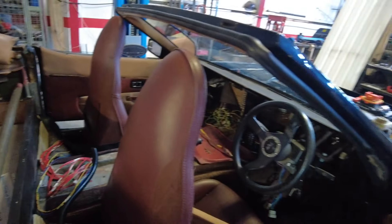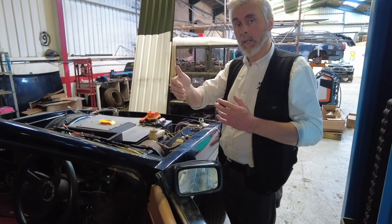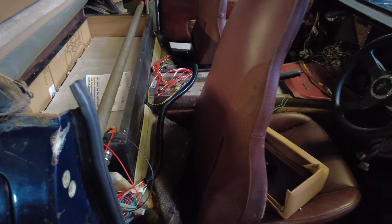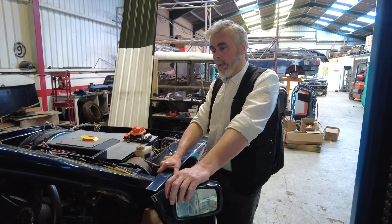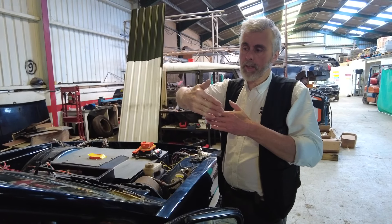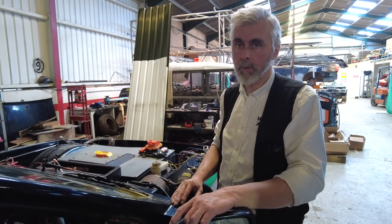All the battery boxes are insulated with a rubber-based paint, but whilst we're installing modules, we want extra protection. As we're actually putting the modules in, they're big and heavy and awkward — and with the TVR being the wrong shape, everything's really tight. We don't want to damage that rubber coating in any way, so we're just protecting it with cardboard whilst we fit the modules in, and then we take the cardboard out. We've also had a slight change of plan on the battery box design. Having assembled the top box, it was really awkward. So we've designed another top box which has got the coolant coming out the back of the box down the rear bulkhead — we've now got a little bit more clearance there. We rebuilt a second top battery box with a slightly different coolant path in it.